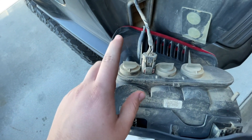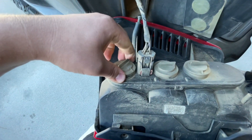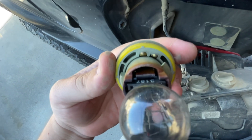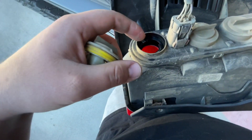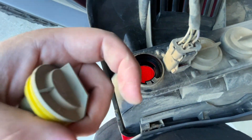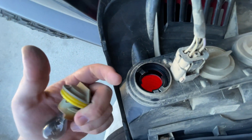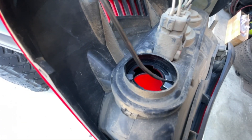The top one is the brake light, this is the turn signal, and this is the reverse light. We're gonna work on the brake light — these just twist off and they might be a little tough so you might need pliers. Here's where you gotta pay attention: you see those two gold tabs? Those have to touch the little metal tabs inside. Sometimes they get pushed down — that one looks like it's down so we're gonna pick it up and stick something under there, like a piece of a zip tie, just to keep pressure up.